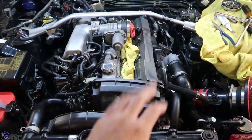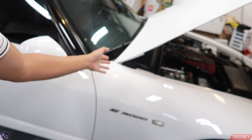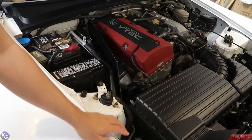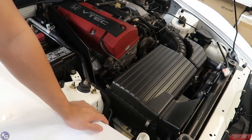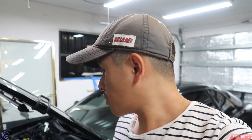I really want to get the Skyline running again because I don't like seeing it in pieces. I also need to start working on the S2000 — just do an oil change, it's about that time at 3,000 miles. I also want to redo the spark plugs and gap them properly. I'm starting to hear the timing chain tensioner go bad, so I'm going to need to replace that eventually, just not right now. The main part of this video is the Skyline. So I'm going to go ahead and put on time-lapse and try to remove some more components, and hopefully everything goes smooth.